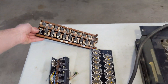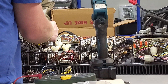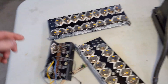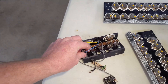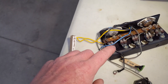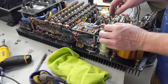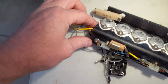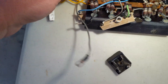These are some of the parts that I've replaced. When Jim McCullough originally diagnosed this controller he started testing these transistors — in the controller there's 80 of them. There was one here that was bad and one here that was bad, and Jim thought that potentially more could be bad on these strings. This is also one of the logic circuits, one of the drivers, and he tested that this diode here is bad and these resistors are all bad — they should be much brighter colored than they are. He also tested all these transistors and found that this transistor here is bad, which is on the same string as one of the worst sets of resistors.